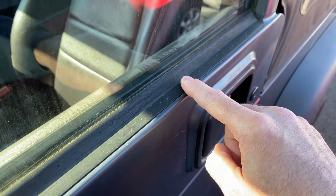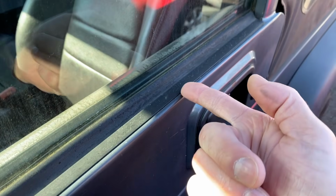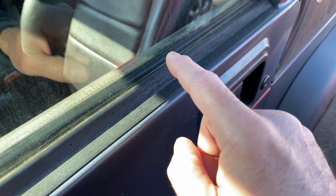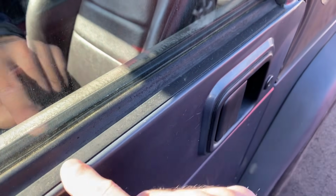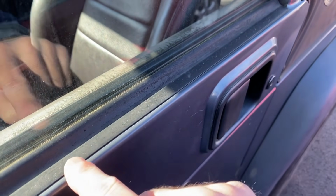Now some vehicles, as shown here, have the rubber strip mounted right onto the door itself. This is a lot easier because all you would need to do is either take a blade and scrape the adhesive off underneath, or you can just use a heat gun. If you want to see a video I did on how to remove weather stripping using a heat gun, you can check that out via the link above. I'll also have it down in the description. But if you heat that up real good, get the adhesive to loosen up, you can peel that right off, clean it real good, and then apply your new one.